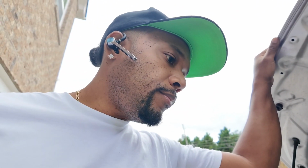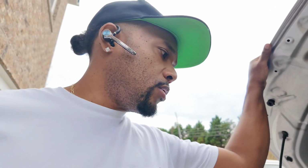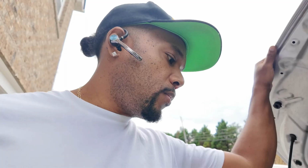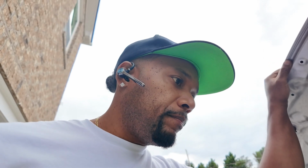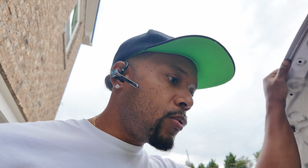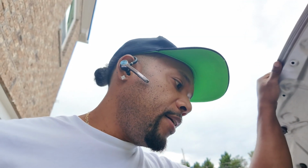Anyhow, it was weird because when I clear the codes in the car, it starts working fine. The car drives good, everything. As soon as you go up the road, get on it a little bit, and then come to a stop and move off again, the code comes right back for cylinder 1 misfire. Whenever it does that, this injector stops pulsing. Clear the codes, it works fine. So obviously it's picking up something. I'm not sure what it is. There are no other codes. Maybe you guys have come across this problem. It's a 2015 Corolla. I've never seen this before. When you clear the codes, it runs fine. As soon as you get on it, it comes back, it shuts down injector 1. Injector 1 stops firing and starts misfiring.